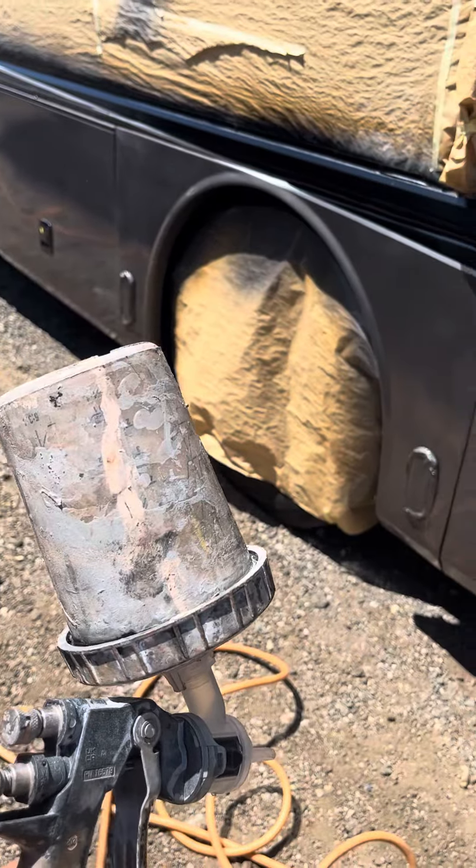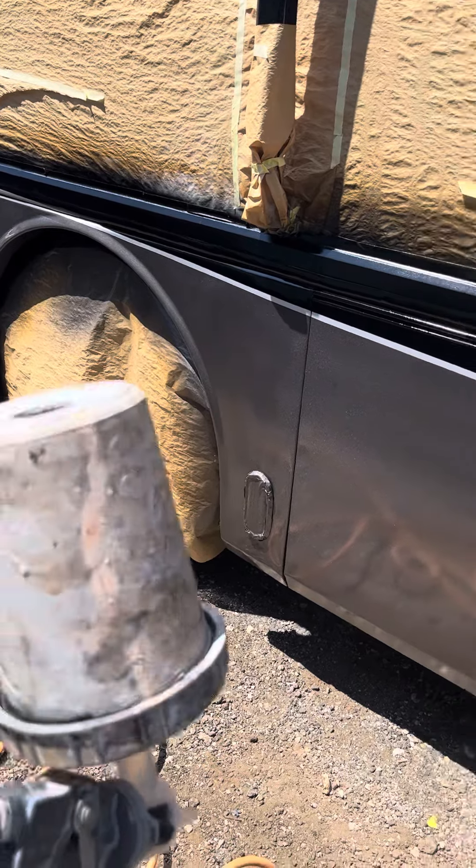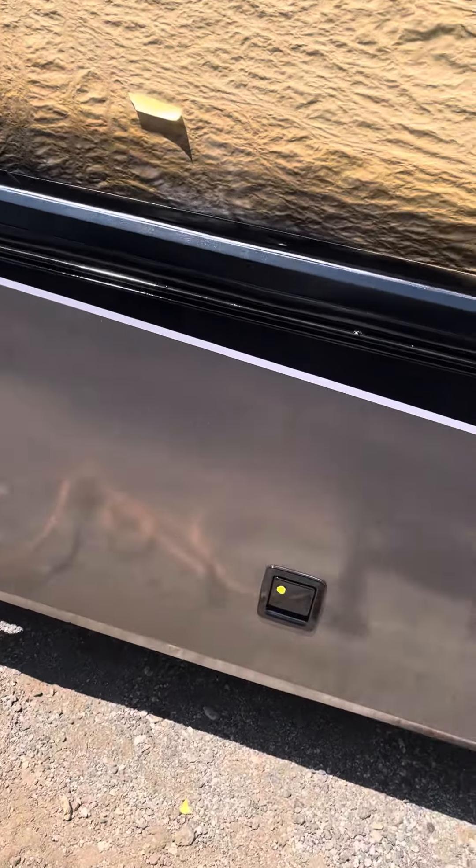With that fine atomization, you don't get fisheye. Not only do you not get fisheye, but you don't get too-big splatters. They're real small, real fine splatters, as you can see — just real fine.